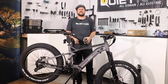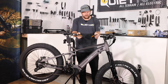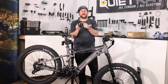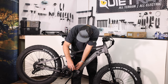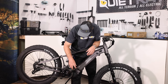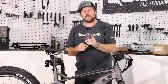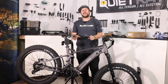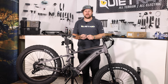Once all four are tight, you're ready to go. The next step is installing the pedals, so go ahead and unwrap the pedals from the cellophane. You're gonna notice that they're each labeled — on the pedal with the sticker, we have an L and an R to indicate left and right. We'll start with the right pedal, which has the R on it. If you don't have the sticker, you can tell by the thread direction — this is a standard thread, meaning righty-tighty, lefty-loosey. Line this up and just very slowly start spinning until the threads grab. It's very important that we do this slowly and do not cross-thread the crank, as that can be a very costly repair. Once the pedal is threaded on, use a 15 millimeter open-ended wrench or bicycle pedal wrench around the pedal chassis and tighten it down. This doesn't need to be super tight because as you're pedaling forward, you'll inherently be tightening — so you want this to be nice and snug, but not so tight that it seizes in place.